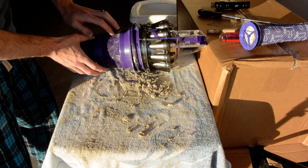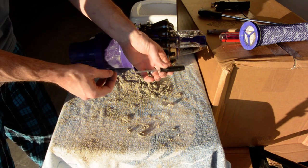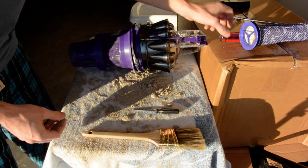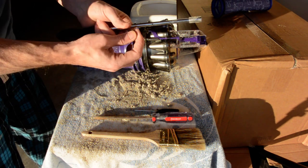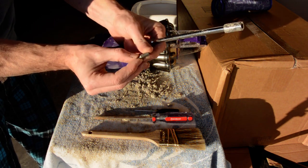The first question I found was how to get this little basket off. So the tools you need for this job are one of the smaller screwdrivers, a paintbrush, and a large screwdriver. And last but not least, you're going to need a special T tool that has a star pattern on top — this size is a T15.